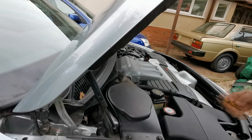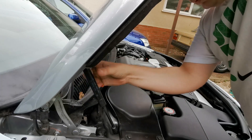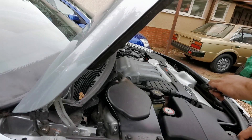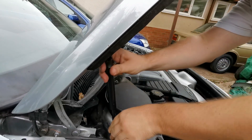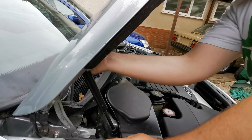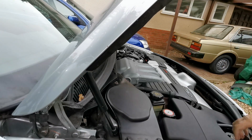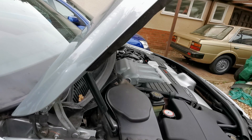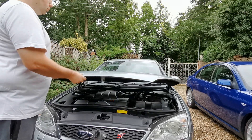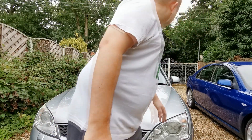I'll try to bring you in a bit for this one. I use my head as a lever up, so when we take the weight off and take this strut out the bonnet wants to drop down. Just pull that one off. Right, bottom one in first — just clicks in. Close that bracket up, make sure the bottom one's clipped in — which it is. That's a straightforward job, and now I don't have to worry about this dropping on my head. Let's make sure it all shuts properly — all the lines are right, it's not raised at the back. Happy with that.